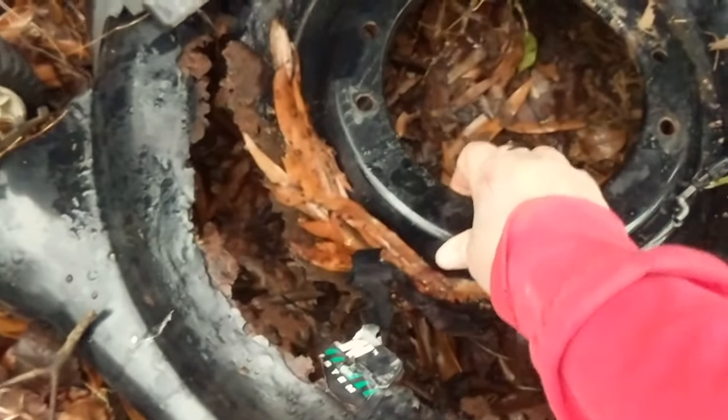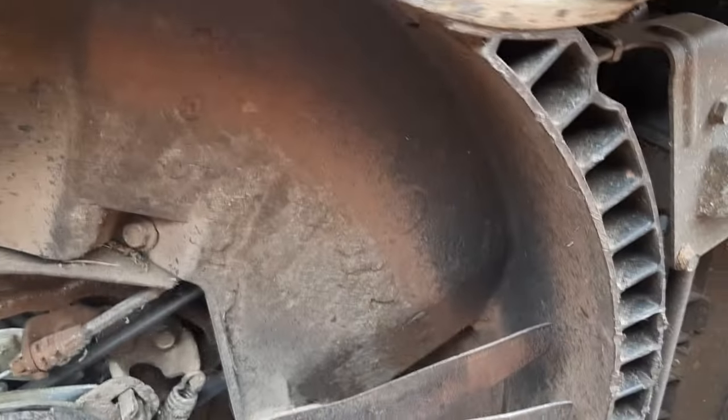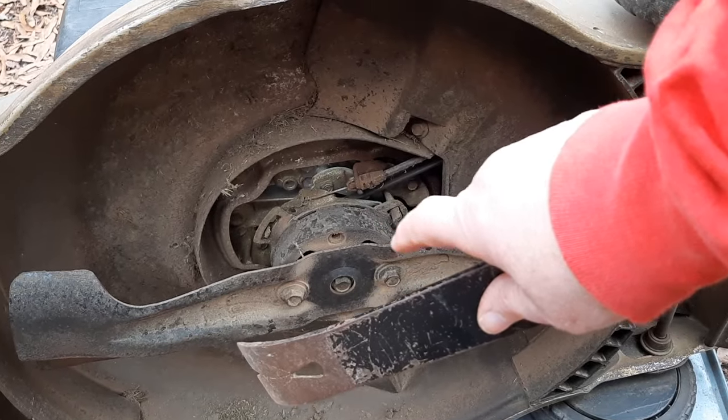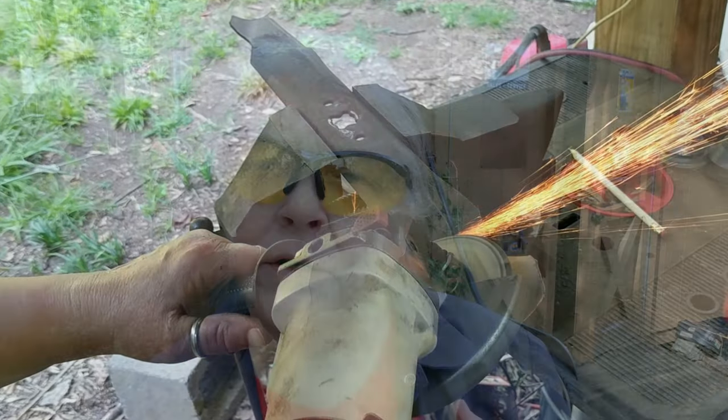I don't see any rust or moisture under there. This guy obviously doesn't mow wet grass, so I think we're good to go here. But you could always hit it with a power washer if there was too much. So if your blades are really dull or there's a lot of divots in them, I'll post a link in the description of how I sharpen Honda lawnmower blades. I use a bench vise and an angle grinder. I know it's some specialty tools, but yeah, you might have to do that.